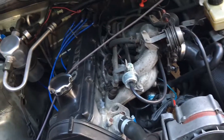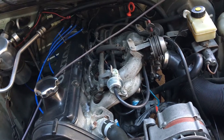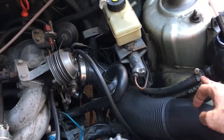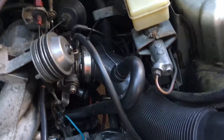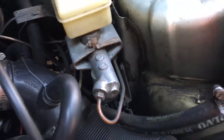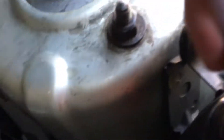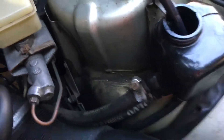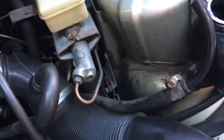The point of connecting to the upper hose with the suction pump is that as we pour fresh fluid in there, it's going to drain into the system and we're going to pull it out this way — running it all the way through the system to get the maximum we can out of there. So next step: we've already started draining it and connected to the upper hose.